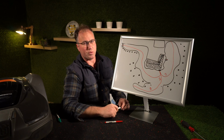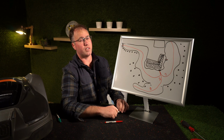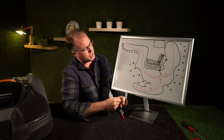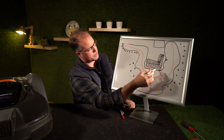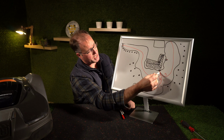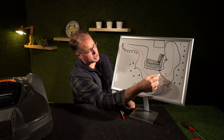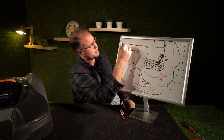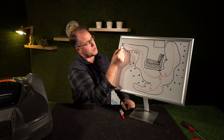So someone in the comments is probably going to say at some point, okay, that's all good, but you can only have a 400 meter guide loop. So when Husqvarna talks about a guide loop in the manuals, the guide loop is the boundary, so the black is the boundary here. And when the current comes out of the charge plate along the guide, it's about 4.5 volts. That goes into the boundary, which is at 28 volts.